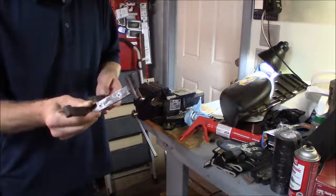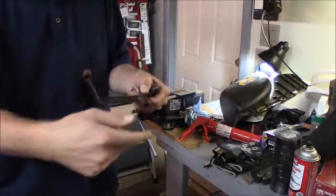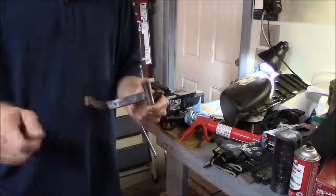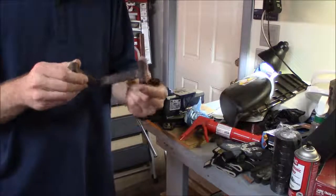What the brake does more than anything is brake the input shaft. You have that input shaft turning once the motor starts, and when you go to put it in gear it will just grind the gears away. There's a lot of talk on the forums about gears being worn out from people not replacing the brakes.